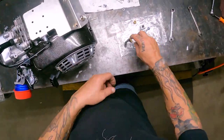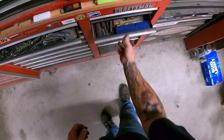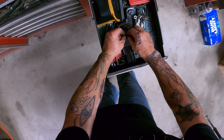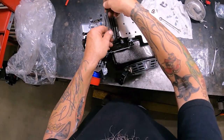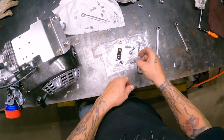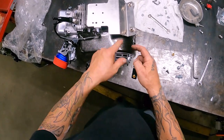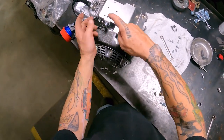I'll tighten this up here in just a second. And this other bolt has a lock nut with it. Let's go ahead and get an Allen wrench. Let's see, it should be this size. Put that right there. Let's go ahead and just tighten this one up so I don't forget about it. Now this other bolt will go to your bracket, which is gonna mount right here like so. And there's also a hole in here that they put in the top plate, so you could take one of your factory springs. This spring is pretty stiff that's on here, so you're...